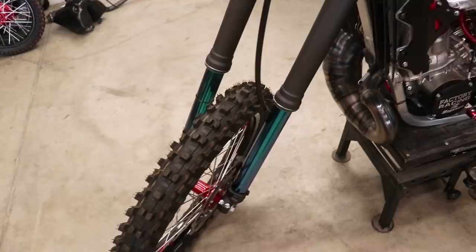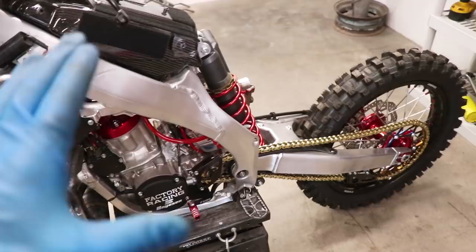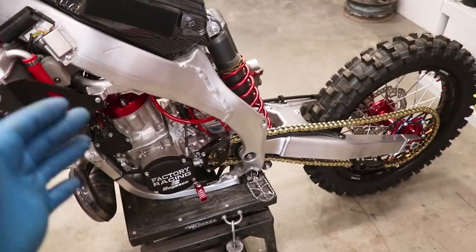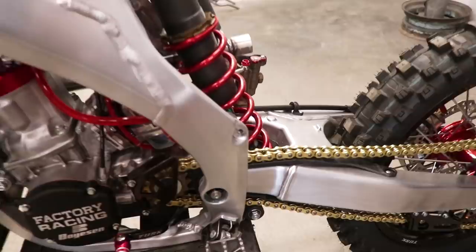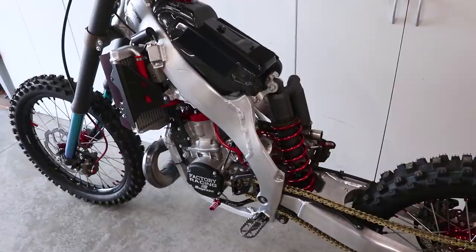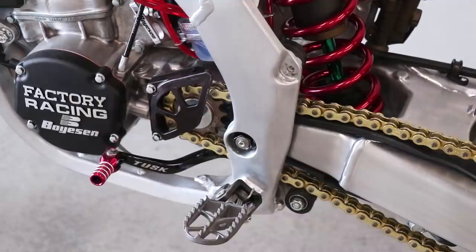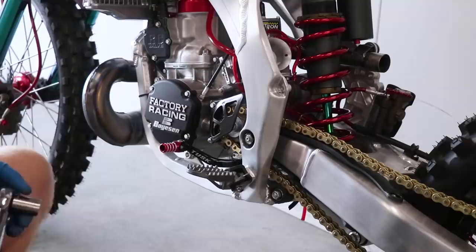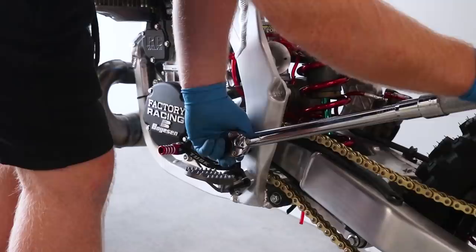Here's a pretty cool concept I learned from Trey Canard's mechanic Brent Presnell. You can align the rear suspension with the motor in the frame — everything works as a whole. Have your rear shock bolts loose, along with your linkage bolts, swing arm pivot, and all your engine mounts. Lean the bike up against the wall, jump on it, compress the suspension a few times, and let it slowly return to its natural spot. Then start by torquing the swing arm pivot bolt — that's the very center of the bike where everything pivots and arguably the most important. The swing arm pivot on this bike calls for 65 foot-pounds.